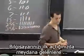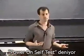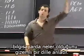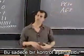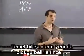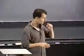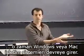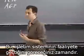But long story short, what's happening when you first turn on your computer is what's called the power on self-test, aka POST. This is just one of the things your computer does, and it often reports to you in sometimes arcane language what it's doing, but it's just the process of checking, hey, do I have a mouse? Hey, do I have a keyboard? And once it's certain that it has all the basics in place, that is, everything's connected, then it says, all right, Windows or Mac OS, take over from here. And that's when you would then see the operating system start to kick in.